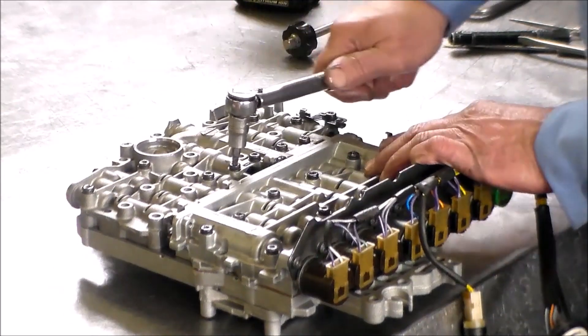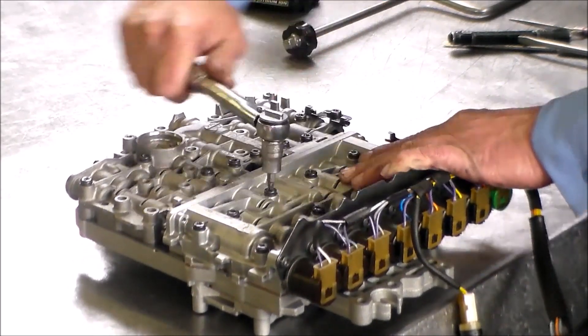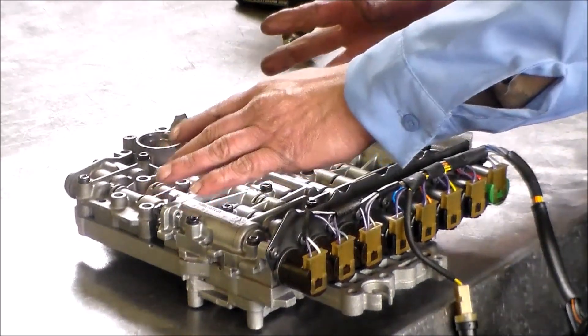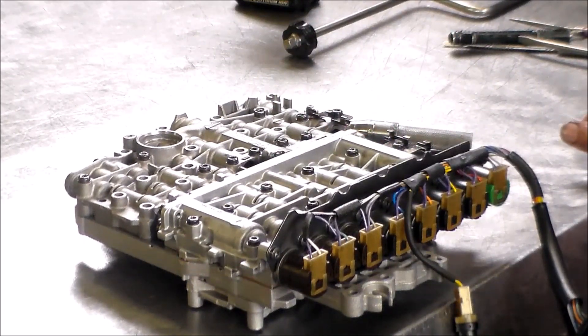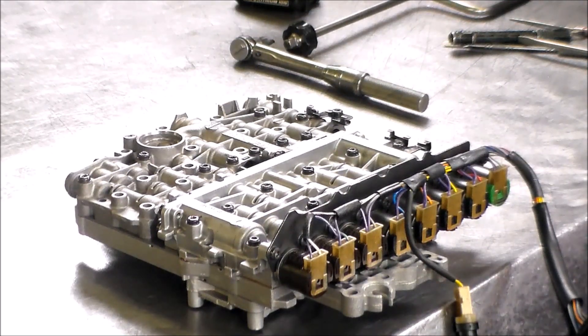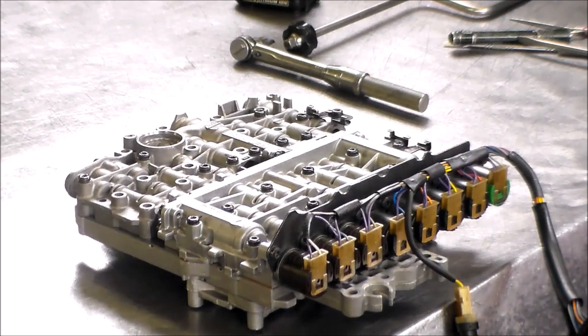These are also 80 inch-pounds. I'm going to start from the inside and go out. Basically I just wanted to go over the switching of the parts and the little tricks to make it a little easier on the front lower half of the valve body on a 5HP24 — and this goes for any of them, whether it's a Land Rover or whatever, it's all the same on the bench. This one is a 2000 Jaguar XJ8. I've got a BMW coming in in a couple of days with a 5HP24 — they told me it was slipping going into drive, common problem, thinking the A-drum on that is blown. That's about it for this 5HP24 valve body. Thanks for watching, have a great day, and we'll see you on the next one.